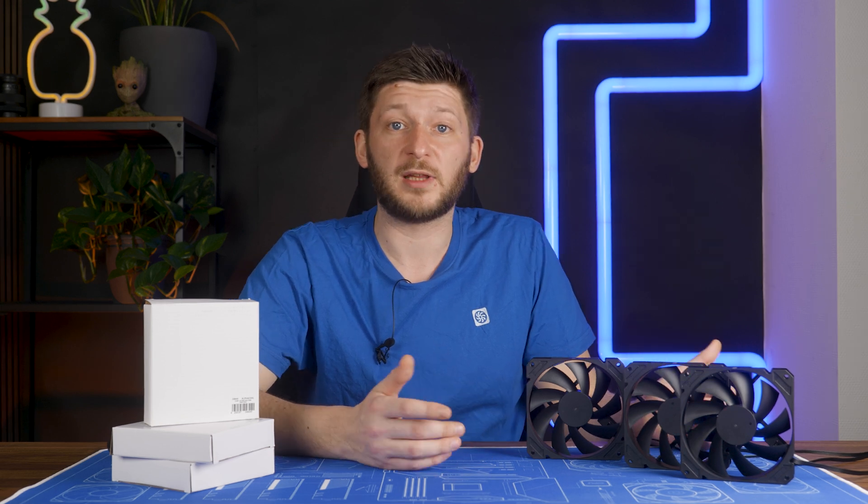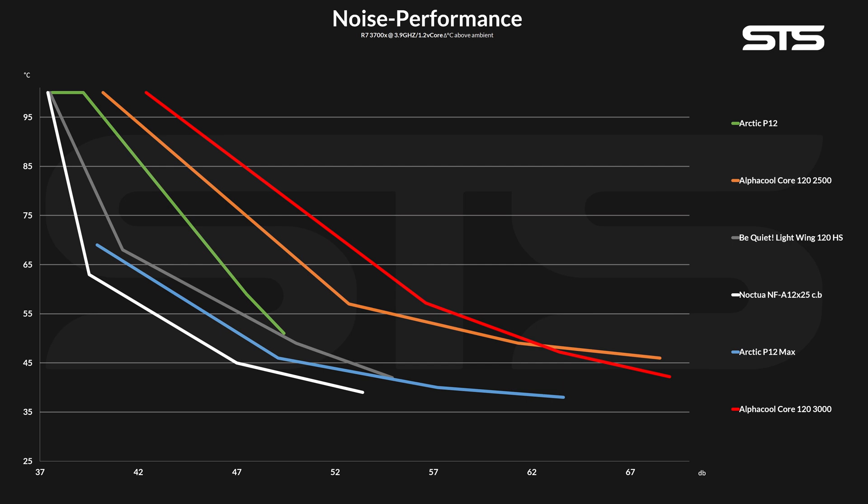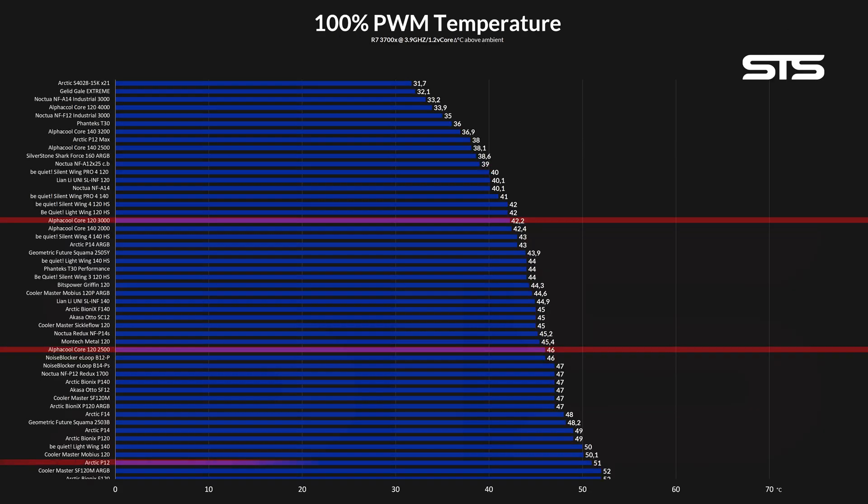And with impact, I mean hearing damage — just straight up hearing damage. But there are really two sides of this coin. Sure, the noise-to-performance ratio compared to an Arctic P12 has just become even worse, but if you flip that, the performance overhead is huge. Whereas before we had about 5 degrees C, now we are close to 9. Still, keep in mind our benchmark creates bloated numbers, but as a reference divide them by 3 to get an acceptable real build result. And then we would have 3 degrees C less compared to an Arctic P12, which is kinda good. It will damage your ear if you stay too long next to this thing, but 3 degrees C is quite a lot.